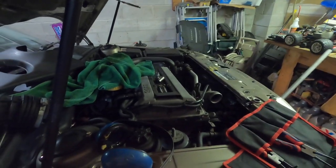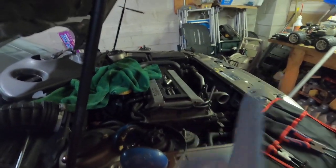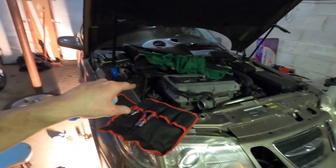It's late tonight. Change the oil real quick — which takes 10 minutes — probably while buttoning up everything else. I'm not going to show you everything because it's really self-explanatory: crank bolt, belt, then re-torque everything. If you guys want, I can give you the torque specs on the engine mounts, or I'll link a video where I've given all of that information once before. That crank seal was definitely the culprit of that oil leak, the way it was splattering. And as I showed earlier in the video, there was no oil leaking from the top down — whatever was on top has been old oil leaks from a long time ago, so nothing to really be worried about there.